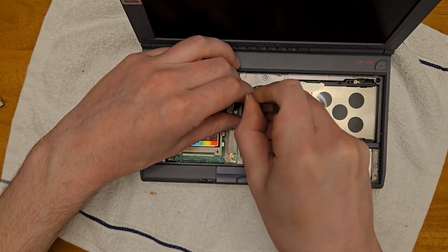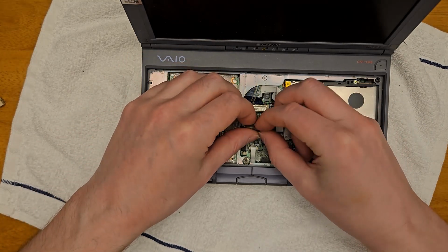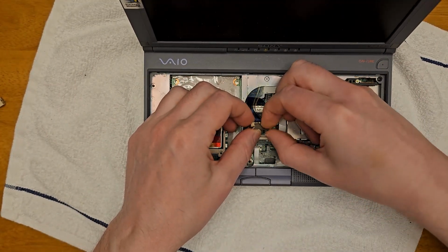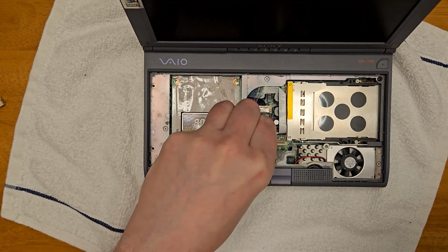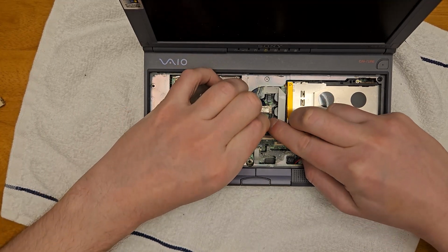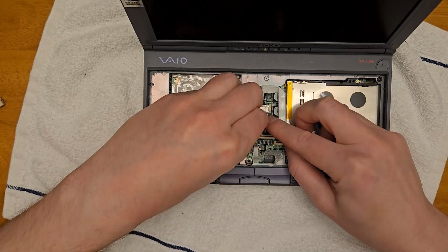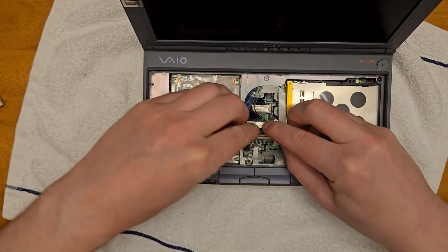So I end up taking it back apart, and as I'm inspecting it, I realize that the ribbon cable is missing the little blue translucent piece of plastic at the end of the ribbon cable. This is used to reinforce it, but it also thickens it up so that the little connector can grab it more securely. That's why mine was so loose. I actually remember seeing the little square when I was cleaning up afterwards, not realizing what it was. And also taking it apart, the little blue strip also fell off the webcam ribbon cable. So I think the glue was getting kind of weak, so it's something to watch out for.